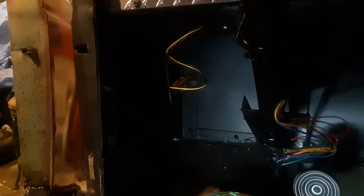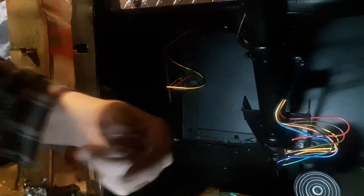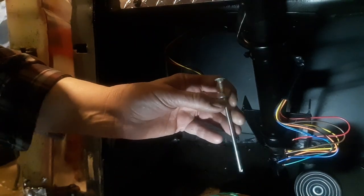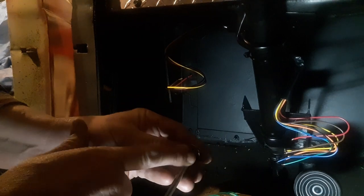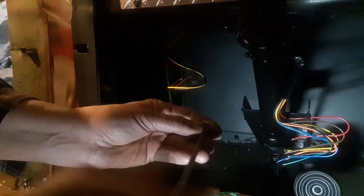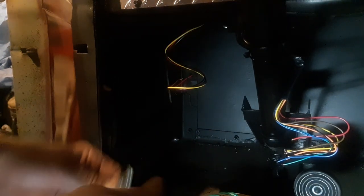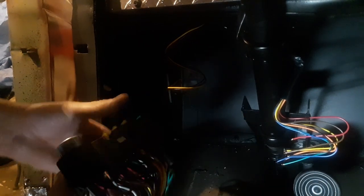So what I do: I run a carriage bolt through the firewall — a long one — and I bolt it up tight on the firewall, then I put another nut and a washer on there, and then I put the fuse box, so it gives me room behind the fuse box for wires. And then I'll put a piece of rubber so I've got room for these wires.